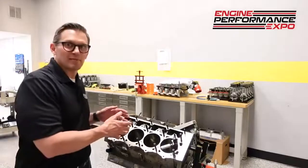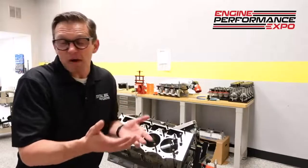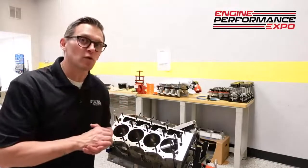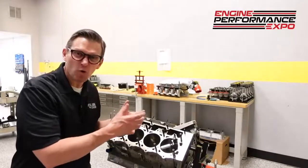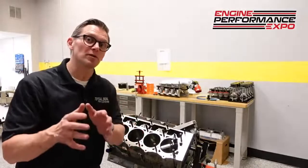This engine's been shut down for maybe a month or so, and you would think that in a month it couldn't possibly have any rust in it. But when we dropped the pan today and pulled it apart — running an oxygenated fuel — sure enough, there was a little bit of discoloration, some corrosion, a little bit of rust in the cylinders. So what we're going to do right now is take the profilometer and measure these cylinders.